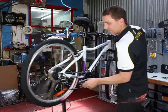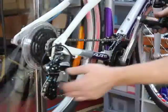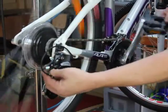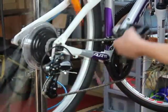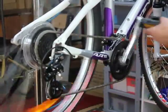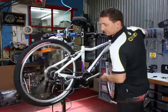Now we just need to set the cable tension. As we go through the gears, just put it into the second gear. Wind the cable adjustment screw out until we hear it wanting to go up into the third gear, then back one and a half to two turns. Then we should have full range of movement and the rear cassette.